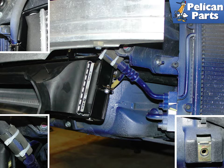Here are some installation details for mounting the front radiator. I found that the radiator bracket leaned against the air conditioning hose and would probably damage it if it wasn't protected. So I used a small section of old radiator hose and zip tied it around the air conditioning hose to protect them from wear. The lower right insert photo shows the proper orientation of the speed nut fasteners. The chassis should already have these small mounting brackets built into it.